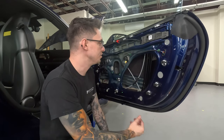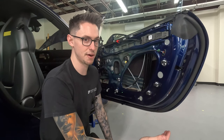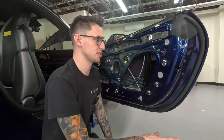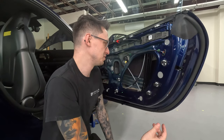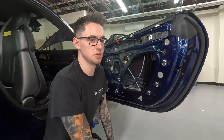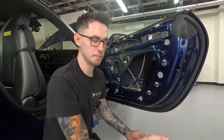You don't have to do as much coverage as I'm doing here, but when it comes to a sound absorber and a noise barrier, especially with noise barriers, actually, let me backtrack a little bit. Noise barriers, to work really effectively, truly need 100% coverage. That's almost never gonna happen unless you're going crazy in an installation. But with a sound absorber, more is better. The more absorbing material you have, the more sound you are going to absorb.